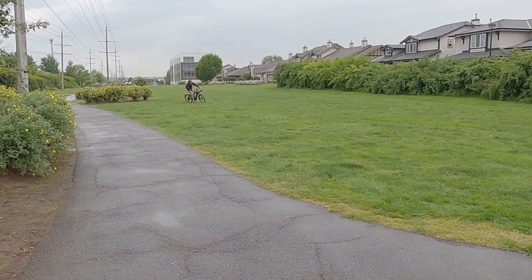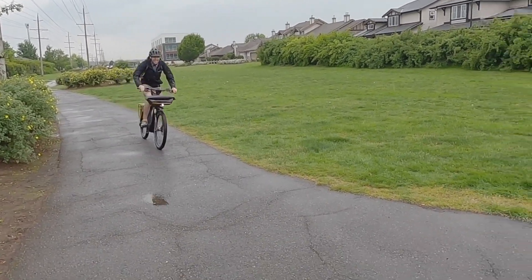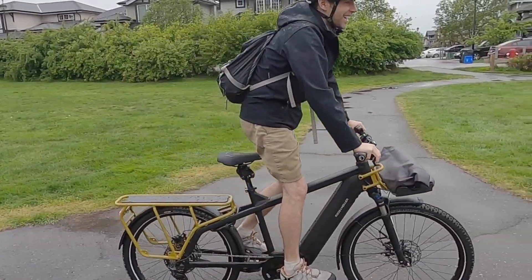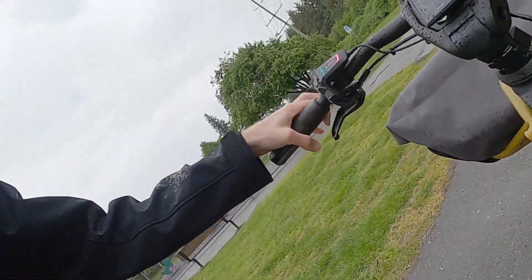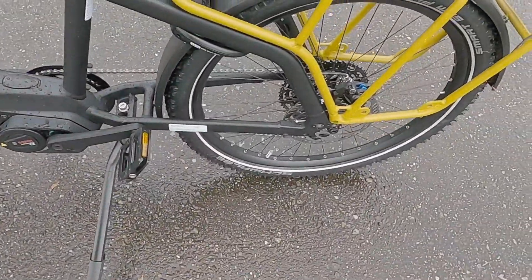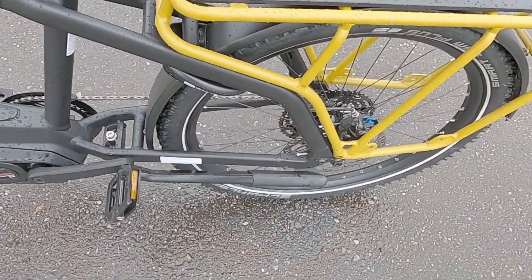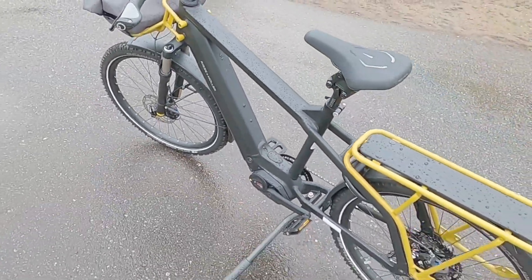This bike is designed to handle heavier loads — it's a mid-tail cargo bike. I like the 26-inch wheel size; you get a low attack angle and higher air volume compared to the 24 or 20-inch wheels you'll see on some long-tail cargo bikes. Those are a bit easier to load because the cargo sits lower, but you can get pedal strikes more easily, and the higher attack angle on those just isn't as smooth when riding over bumpy terrain.